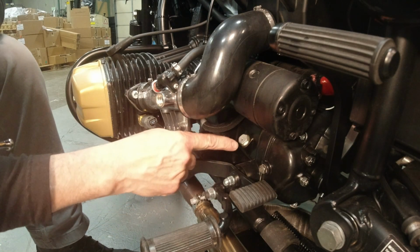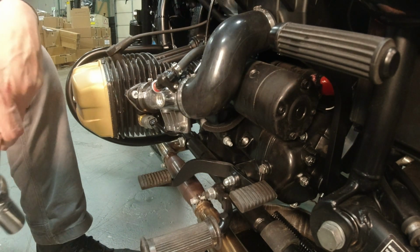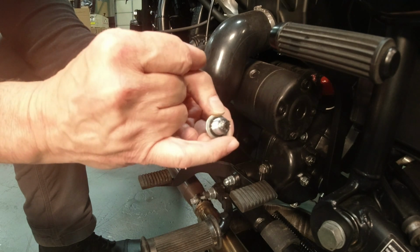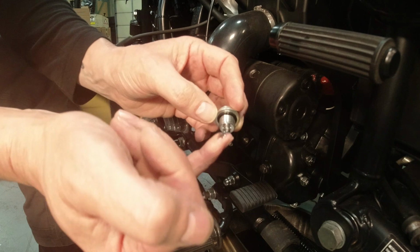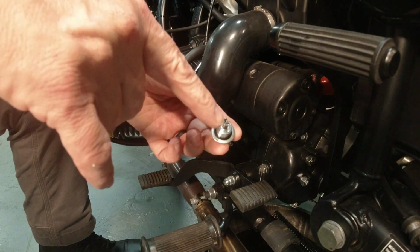All right, moving on to the gearbox. This is the plug where you would check your fluid level and you would also fill it from. Crack it loose so it's easier for the fluid to drain. See how it's got, this is 500 miles, it's got a little bit of fuzz on it. Nothing major. So we're going to wipe that off and continue monitoring it as time goes by. You're going to get a little bit every single time.